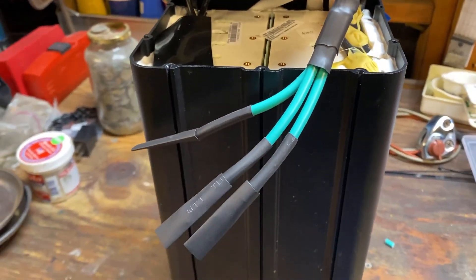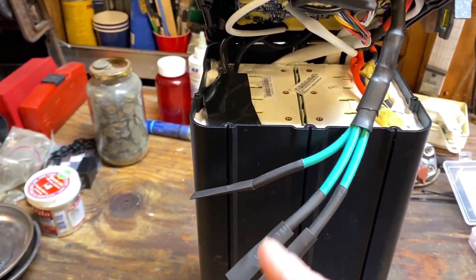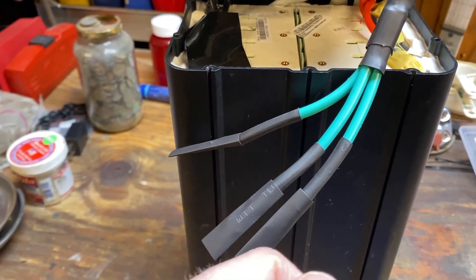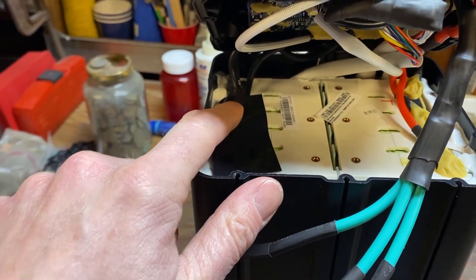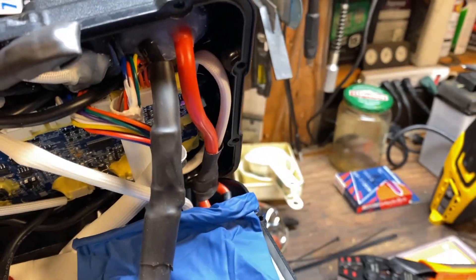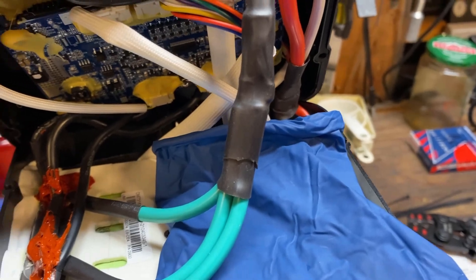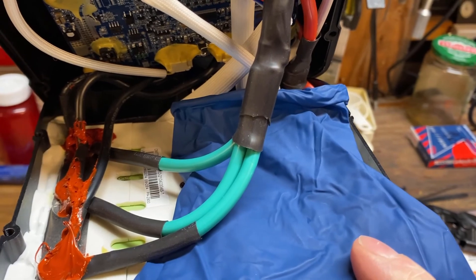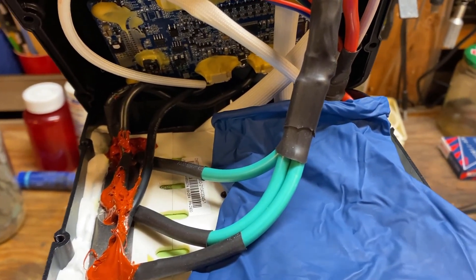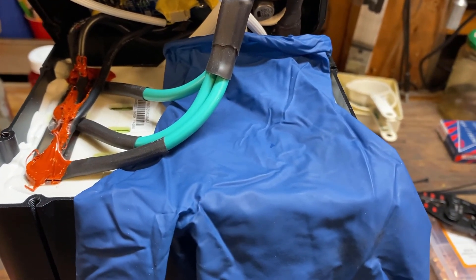I said I'm not going to show you how to do a bypass, and I'm not. But a couple of quick safety tips. If you watch the videos on how to do this, people talk about being careful once you actually make this connection and not letting the other ends touch anything — and that's really good advice. To be really careful, I just put an extra piece of heat shrink tubing on the end, just slid it on there, and when I'm ready I slide it off. When I'm working on the battery, I keep the terminals covered with electrical tape. My final piece of advice: when you go to strip the negative wire, it's stranded wire with very fine strands, and little pieces might fall out onto your battery — you don't want that. I put down a blue rubber glove, and the tiny little pieces fall on the glove instead of in the battery. You can get rid of them and have peace of mind knowing you don't have tiny pieces of wire floating around inside your battery.